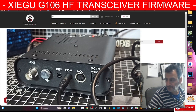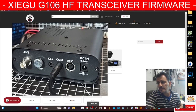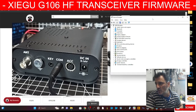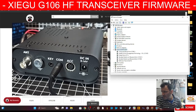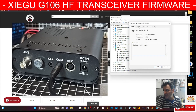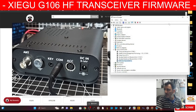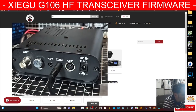You'll hear your computer make a noise. Right-click on the Windows square, go to Device Manager — this window will appear and you can check your COM port number. Mine is 15. Right-click it, go to Properties, then Port Settings, and make sure it's set to 115200. So: 115200, COM 15. We can close that.